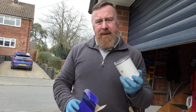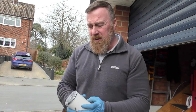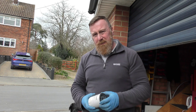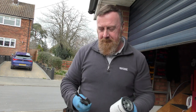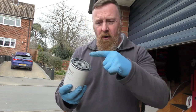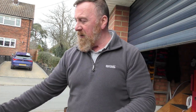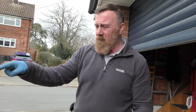We're down to the last filter and getting the oil as well. And I am so impressed — I know I've said this from eBay — but £20 for the whole set. Two filters, air filter, and the diesel filter. Oil on top — I understand that. Can you imagine what this must be costing you in the garage? I have my little trusty filter extractor. I just went to touch it — I'll just check it anyway, because there's oil everywhere. Remember, I'm leaking like a sieve. There's hand tight and there's absolutely stupid. Remember when you put these on — bit of oil, run it round the lip. Let's see how dirty this one is — it just sort of tells you how long this filter has been on there.